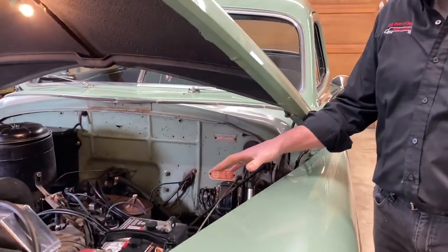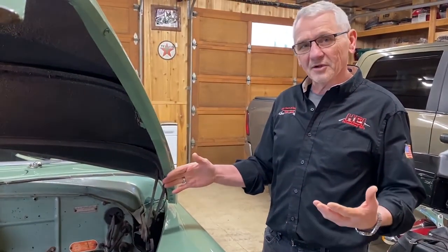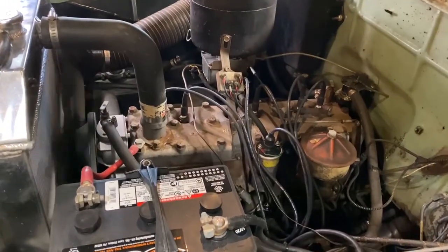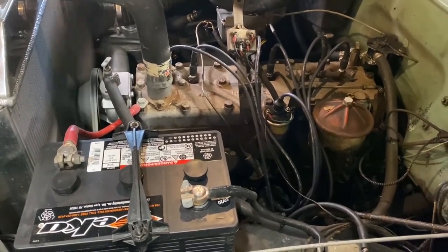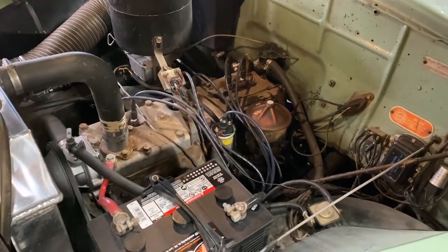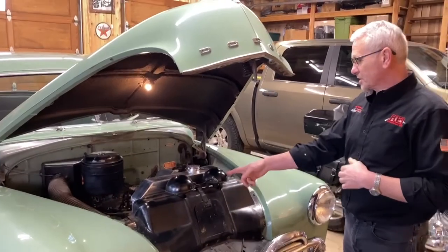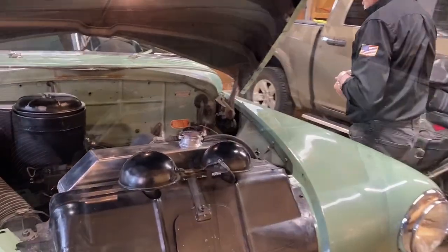And again, being 6-volt, a lot of people complain about the 6-volt systems, but if they're left alone and the wiring is properly done, the cables are big enough, the coils are good, they start right up. As you can see, the way it starts and the many thousands of miles we've driven it, that's the way it runs on all of our trips. Just smooth and quiet, just like that. And the 6-volt system works really well. Also, as you can see right up front here, they've got some pretty big horns. So let's take a listen to those.